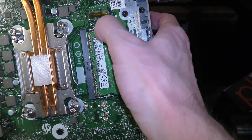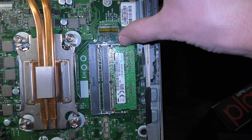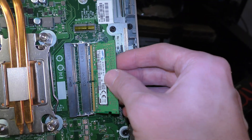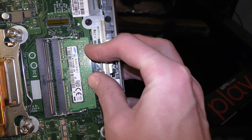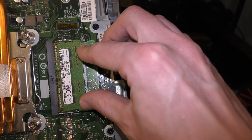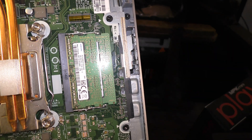I got some RAM for this, so I'm going to swap out the two 4GB sticks for two 8GB sticks to take it up to 16GB. Also while we're in here, I'm going to install an SSD into this M2 slot and see if we can install the operating system directly to that. If that's successful, we'll throw in a 2.5-inch SSD that I've already loaded Batocera on for our retro emulation, and we'll try both of those things out.